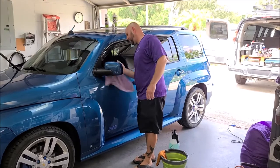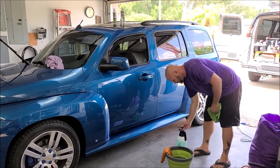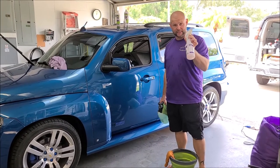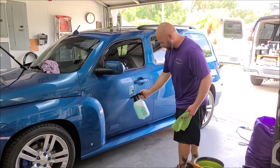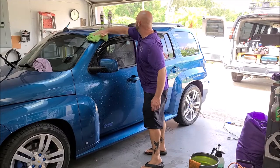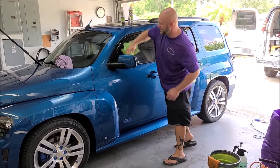The next order of business is to use Universal Clean and Prep to remove any and all wax, sealant, or whatever else is on this vehicle. This dilution is one to seven. What I generally do is put two ounces in the 16-ounce spray bottle and fill it with water — two ounces to 14 ounces of water — as my solution to remove everything from the surface. You literally just wipe it until it all goes away. You will see a little bit of a haze being left behind. That haze is totally normal — it is actually the primer in the product left behind to help protective products bond better.